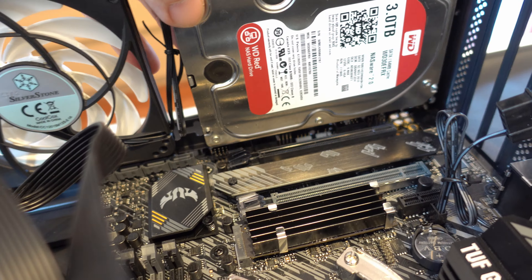Before I managed to order a new case, my wife reasonably suggested that I first attempt to modify the fan a little bit so that it allows all the connectors I would like to have. I've made a little cutout on both edges, and yes — it fits. Both the high definition audio and the front panel connectors can now fit into their sockets.